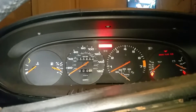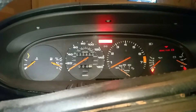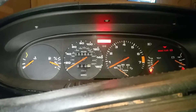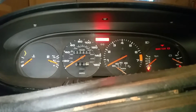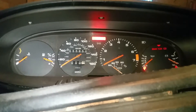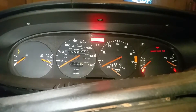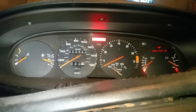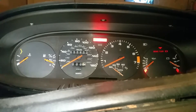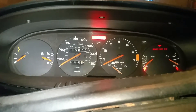We're looking at the fuel gauge. The issue is that no matter how much gas I put in or how much I use, it always stays the same. What we're going to do today is try to troubleshoot this issue from the sending unit, see if it's a gauge issue, and use a multimeter on the ohms resistance setting to figure out if it's the actual gauge or the sending unit that may need to be cleaned.